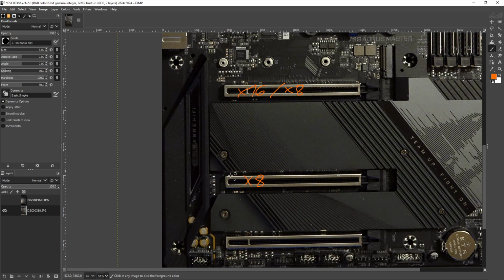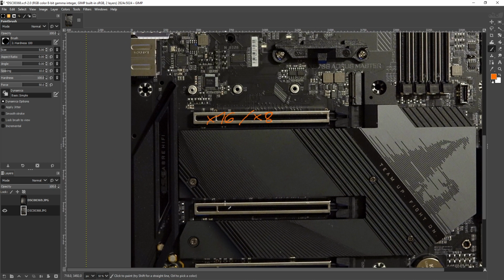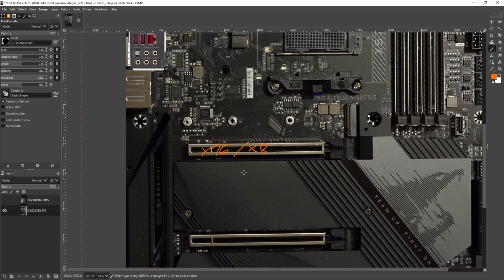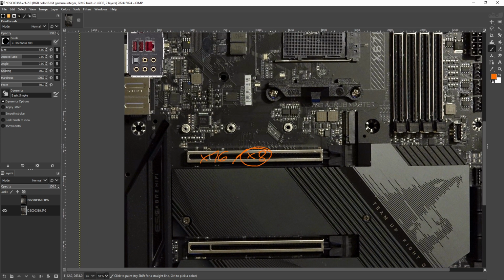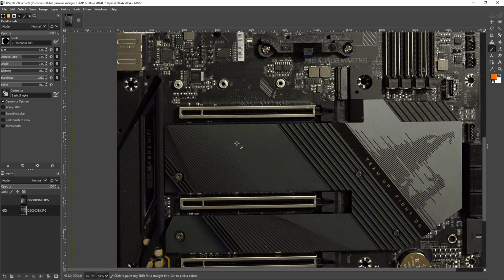That's why I'm a big fan of having more PCIe slots in general. It's nice also when they're attached directly to the CPU. And with PCIe 4.0, running your GPU at X8 4.0 is really not going to be a bottleneck in any current workloads. So having the flexibility to have more PCIe devices is a really nice feature, and not a particularly common one, because PCIe 4.0 switches are really expensive.